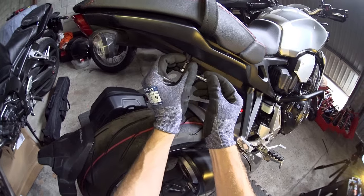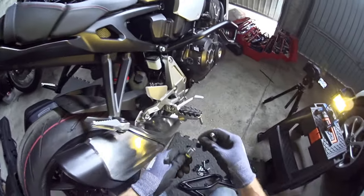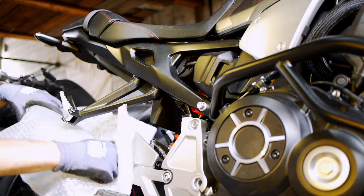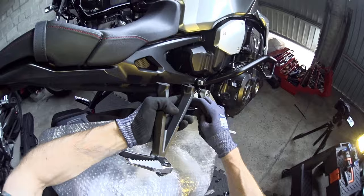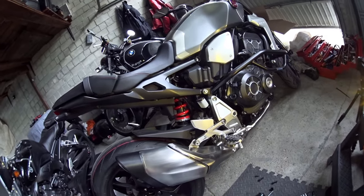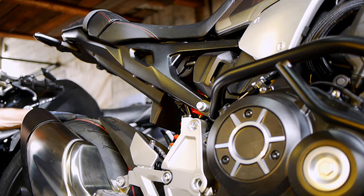There's the bolt out of the back end, and then the bolt for the foot peg hangers we take off with a 10mm socket. Before I go any further, I'm going to stick the bubble wrap from the packaging over that desperately shiny end can just in case I drop the foot peg when I've undone the bolt. Right, that's the two bolts off and the foot peg hanger. That back end just looks even better without a foot peg hanger on it — just wide open. A little end can instead of that one and we would really be talking. Watch this space, I think we're going to be going in that direction.